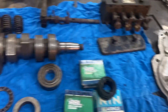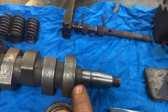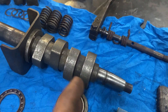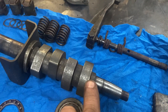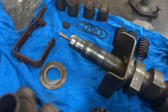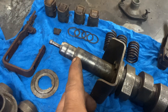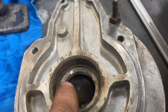I'm going to have to do a little machining on the cases. I could potentially do a little machining on the shaft collars, but at 3.25mm difference, moving the bearing in 3.25mm is going to start to get into interference with the cam follower, and it's also going to get into interference with the sliding collar as the governor actuates out. It's going to be too tight.